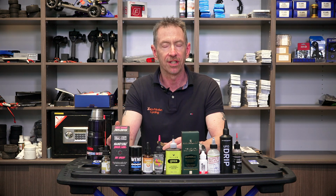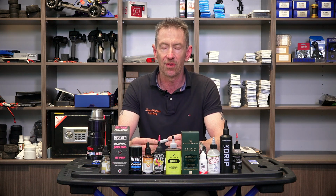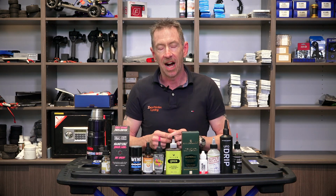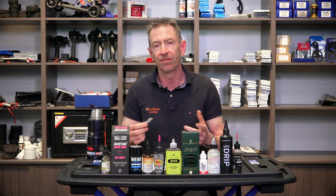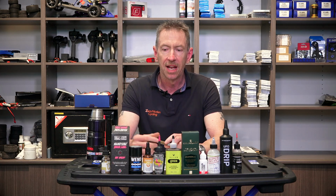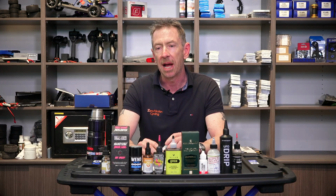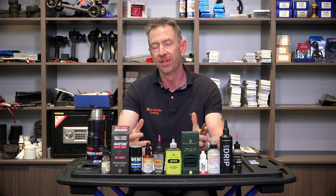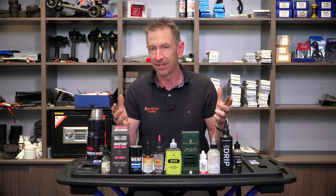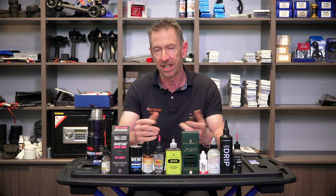Now, some of what you're applying is going to contain some detergent. How much? If you've got somewhere around, let's say, half of it being detergent, then you've got 0.05 mil per link of detergent going onto your chain. How much is that cleaning off the factory grease? How long does it take? How much contamination gets into your chain during the period that it's basically a wet mess where every particle of dust is sticking on contact?